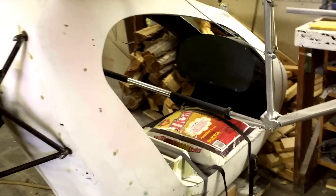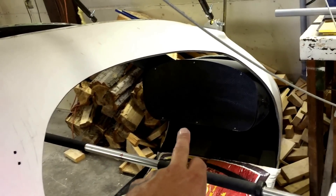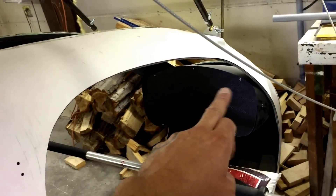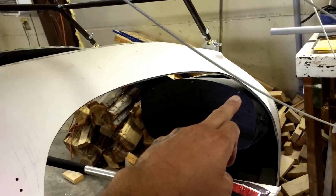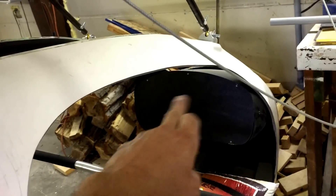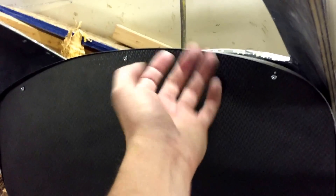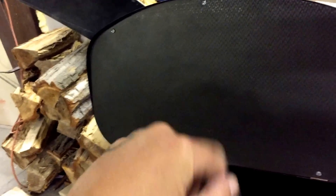I finished my instrument panel face. I have three little hinges down there at the bottom, and then I just used some carbon fiber angle and put some tabs up in there. I just got this fitted up in here and it's nice and solid. There's a little bit of a lip here, which I wanted, so it sits back a little bit more. You can see there's a bunch of room underneath here.